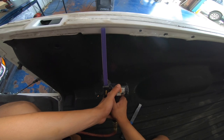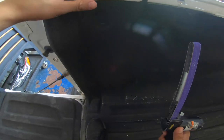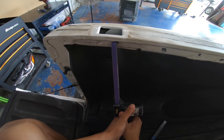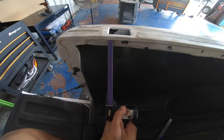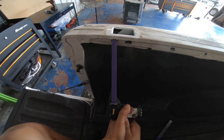What's up guys, I'm kicking this video off right where I left it. I believe the last time I left this video was when I was doing three different spot weld types, but this is basically the removal of the bedside that I recorded last on. And all you're seeing here is my favorite grinding tool, the air belt sander, and I'm grinding down the spot welds along the top side.